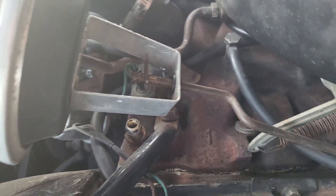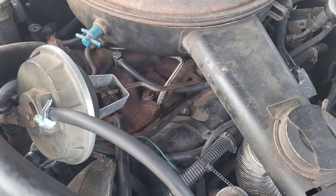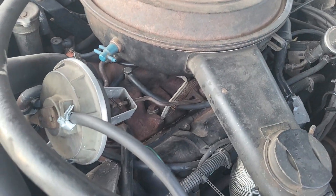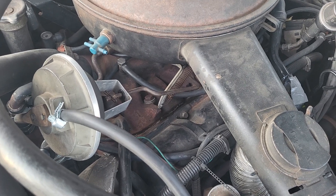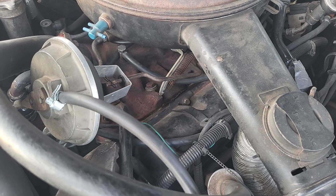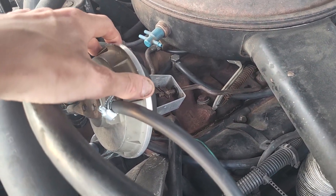It's a little tedious but I'm pretty happy with how this turned out, and the fact that it didn't take long to install once I figured out how to do it. Probably the best part — since I already had the factory servo and the vacuum source through the firewall — it only cost me about $25. The most expensive part was the valve because it's copper; if you bought an aluminum one it would be cheaper. About $9 for the valve and a couple bucks each for the vacuum lines — I only got three feet of the larger and five feet of the small stuff. $25 for a perfectly functioning cruise control system, provided you kept your factory cruise control servo.